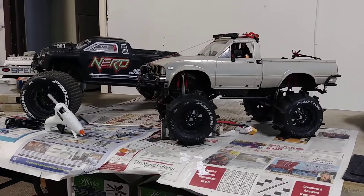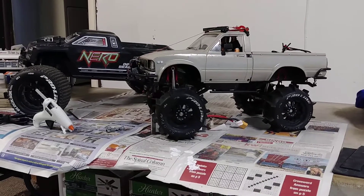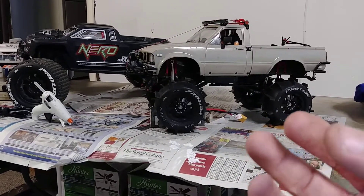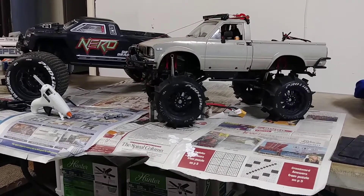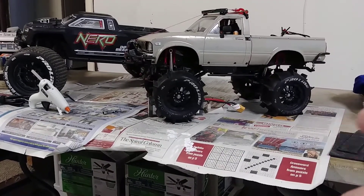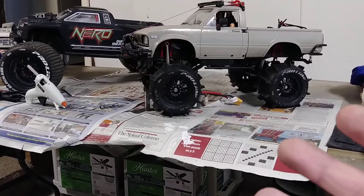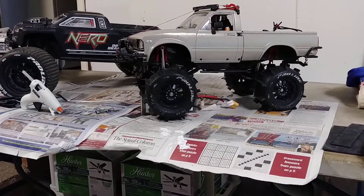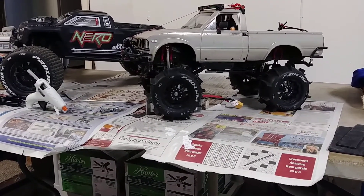For metal or aluminum wheels, it's really a matter of loosening the bead lock, putting your tire in the freezer for a couple of hours, letting the air contract inside the tire as it acclimated to the cold. Then pull the tires out one at a time and tighten the screws back down as quickly as possible before they warm up — or take the tires outside and tighten them down in the cold air while they're still cold. That way the air is trapped inside, and as the tire warms up, the air expands.